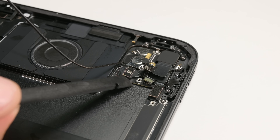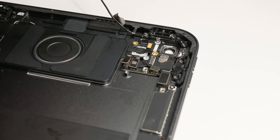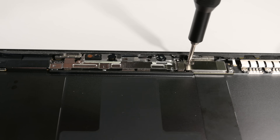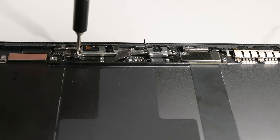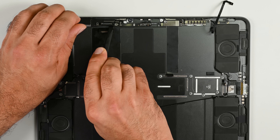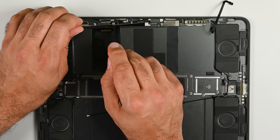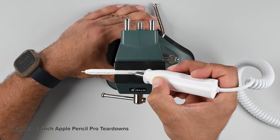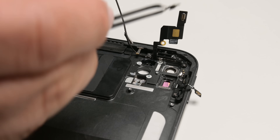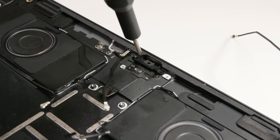With the cowling removed, I can access a few press connectors and nudge a flex cable aside to remove another cowl securing the ambient light sensor and flash. I'll go ahead and remove the 12MP F1.8 rear camera and the LiDAR scanner underneath it. Moving on to the front-facing camera assembly — once the cowling is removed, there are a couple of press connectors and two torx screws on either side, which are the only non-JIS screws in this teardown. Once the front-facing camera assembly is out, I can also remove the daughterboard, which is connected to the front and rear facing cameras and the charging circuitry for the Apple Pencil. The Apple Pencil is still as sealed and unrepairable as always and still contains a lithium battery that can't be replaced. With the daughterboard removed, I can now get at the MEMS microphone, the flash, and the ambient light sensor. We heard rumors that these new iPads might get a second selfie camera for vertical video calls — that camera would sit right where this microphone is at the top of the device, but no camera to see this year.